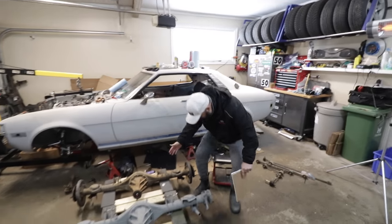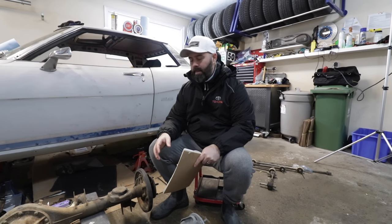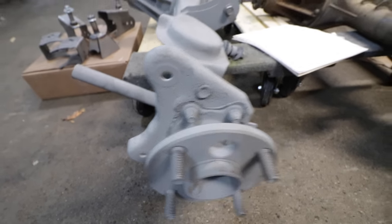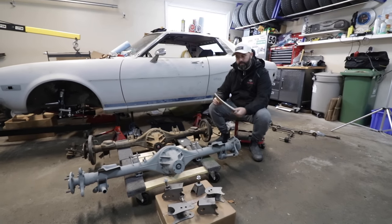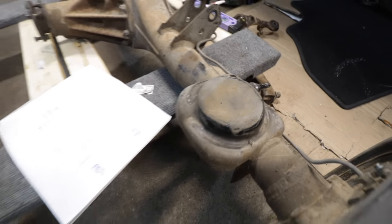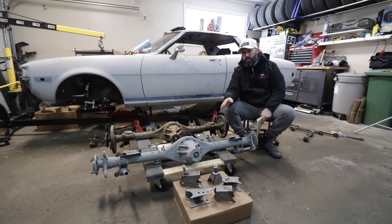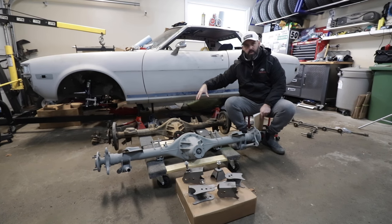These are our two rear ends — this is our original RA-24 rear end, and this is our A86 rear end. There are really two solutions to fixing the rear end for this kind of engine swap. You could run the stock rear end if you want, but if you want rear discs, one way is to swap the axles and flange over to run A86 rear discs on the RA rear axle, though there's work involved and it doesn't come with a limited slip differential. The advantage of the A86 rear end — especially the GTS model — is you get an LSD from the factory, a more common spring perch size making springs much easier to get, and a slightly wider track, about 40mm wider, 20mm aside, which works well since we're going to run fender flares in the rear.